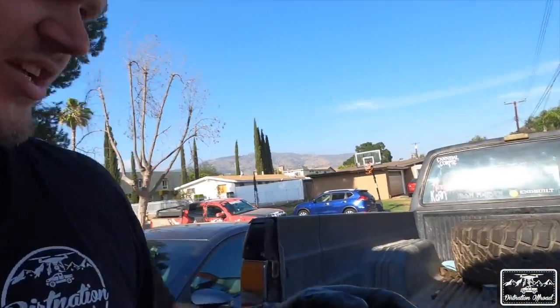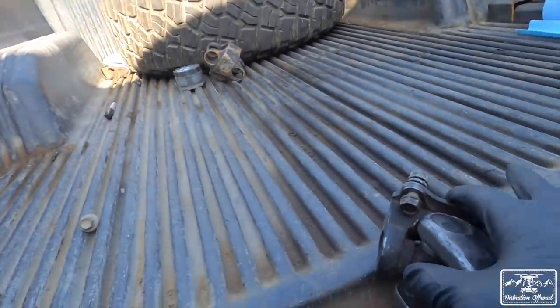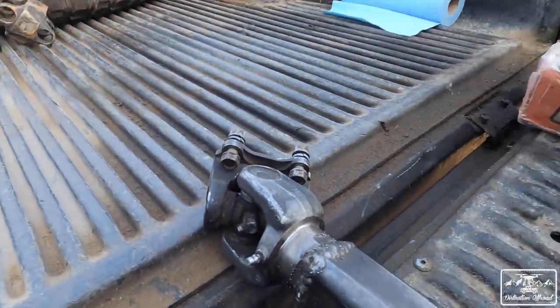He ended up making an end of just like a standard Dana end that fits on some Toyotas, but not mine, because once again, the chain driven transfer case is a problem. If you're doing the swap on a V6 automatic or manual with a chain driven transfer case, you're going to run into the same issues as me, because it's different. The yoke, the flange ends, these right here, those are different on the V6, and they're really, really hard to find. The splines are different, and the flange is different. So that created a whole host of problems.